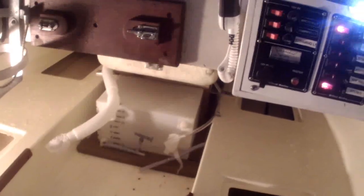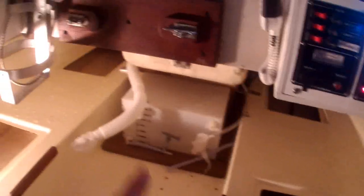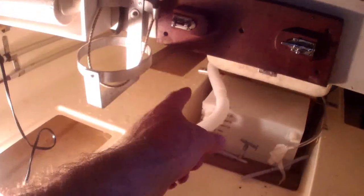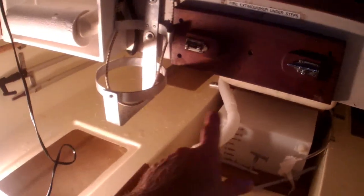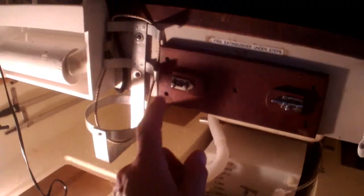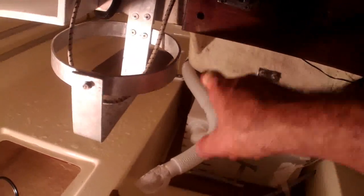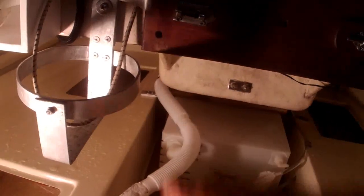And I went underneath, outside, and looking, and finally I started hearing the drip. Over on this side, I got the paint scraper out because I was trying to look for cracks, like stress cracks. And I scraped, and because I could see the drip, I scraped it, put the end in there, and pretty much it looks like a screw hole. So I'm almost guaranteeing that one of these screws on the starboard side must have gone through.